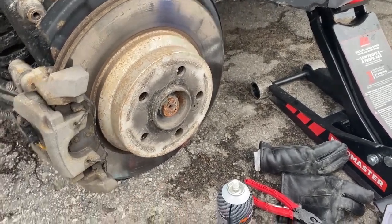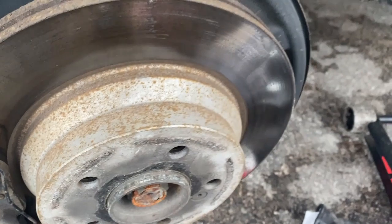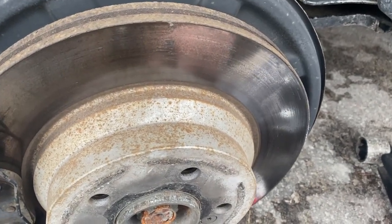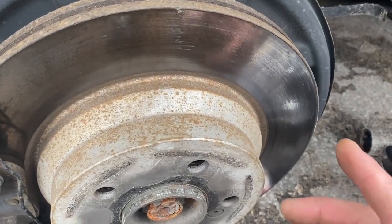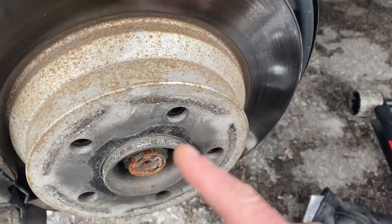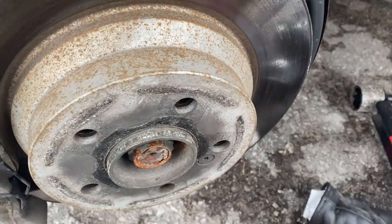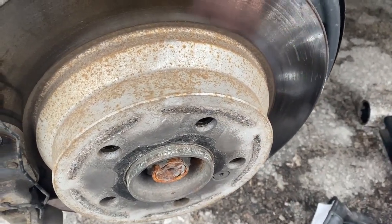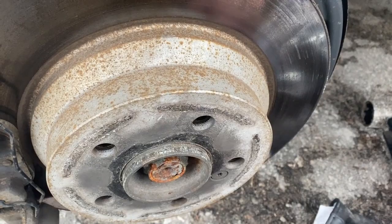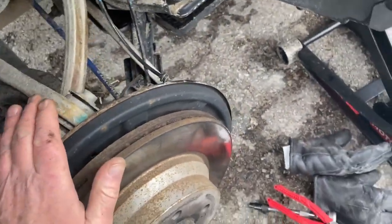I did a live test on my scanner. All the other three wheels were showing the same speed, but this one was showing different — sometimes it would match up with the others, and other times it would be like six, seven, eight RPMs off. Quite a bit off, and that was going in a straight line.